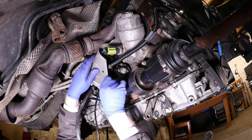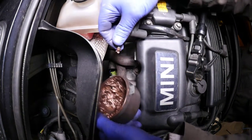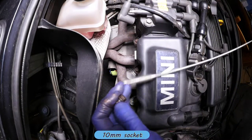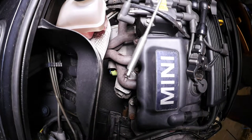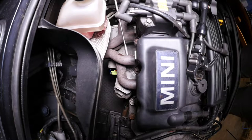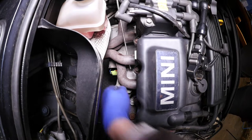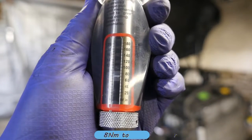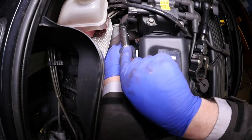Slide it over those dowels, make sure that cable's not pinched at all. There's one nut at the top — I'm definitely putting copper grease on that because it could easily get seized with the heat of the exhaust. That's the 10 millimeter socket. Because the camera was in the way I found it easier to use this little tool just to start the thread off and feed it in, then finish off with 8 Newton meters on the mini torque wrench.